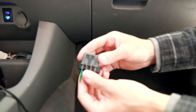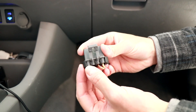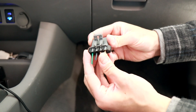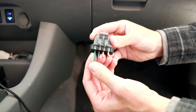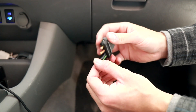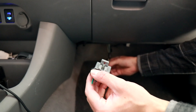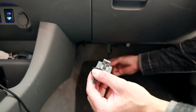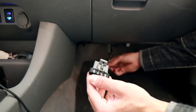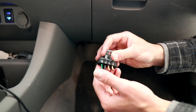Just so you're aware, on the new connector you also have A, B, C, and D. If you get confused on which wires go where, leave yourself a little bit of slack and use the old connector as a reference. For example, green and yellow is going to be your A — connect that to the aftermarket gray which is also A. Use the old connector as a template. Pretty simple.